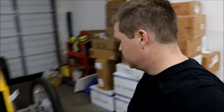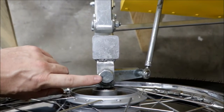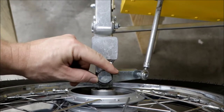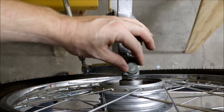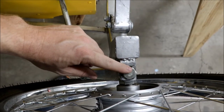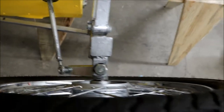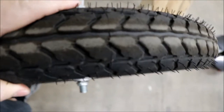We're going to work on the yellow board again, and this time we're basically going to add caster. Right now we have zero caster — the kingpin is perfectly straight up and down, vertically. What we want is for this kingpin to be tilted to the back of the car. Our goal is to add about 15 to 20 degrees of angle on this kingpin, and what that's going to do is make it harder for the tire to jump around.